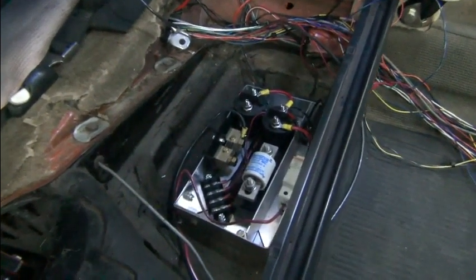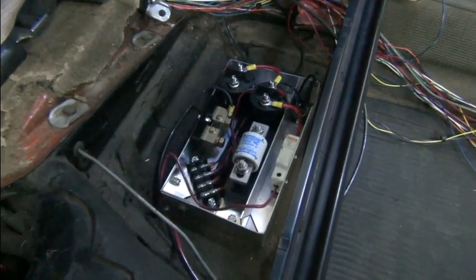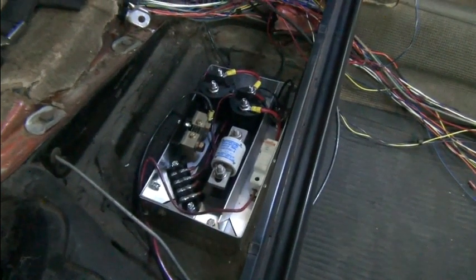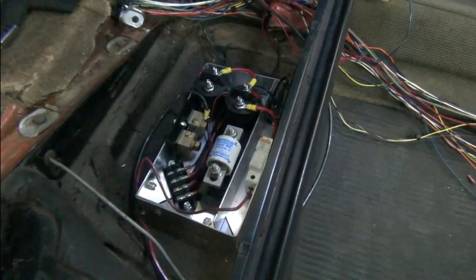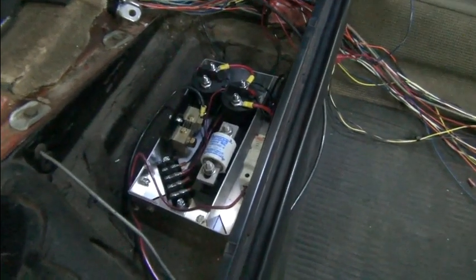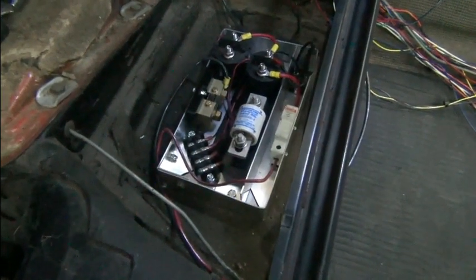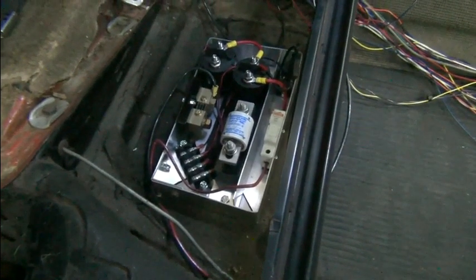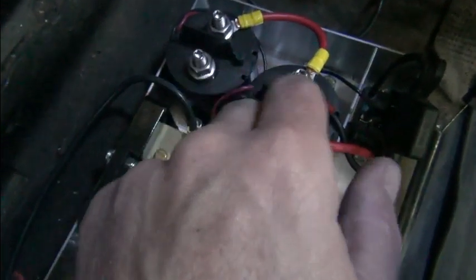I decided to do away with that box — it just didn't fit comfortably in the hole. We have this tray in there now that bolts to the floor so nothing will move around from vibration. You don't want movement causing metal fatigue and broken wires. I went with this smaller tray which will have an ABS cover over it, allowing easy access to the components.